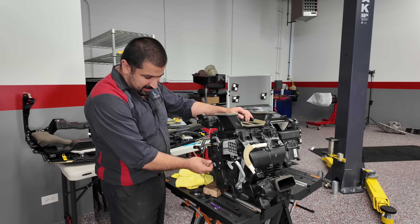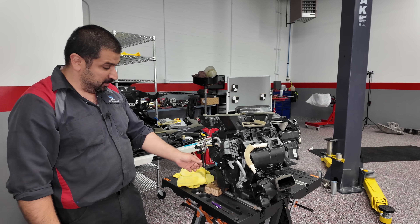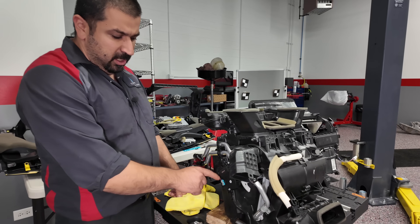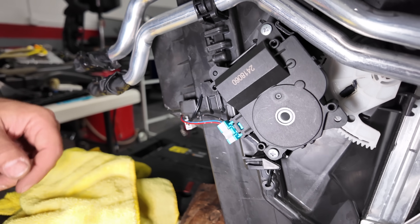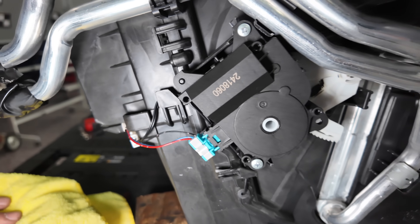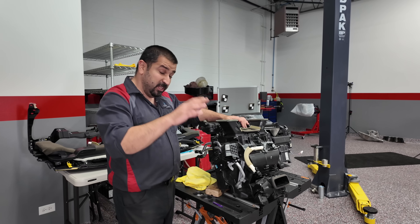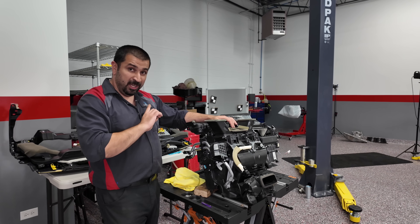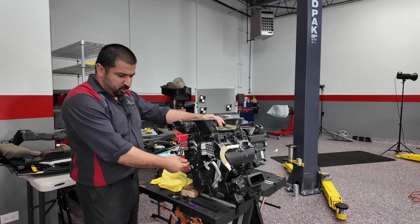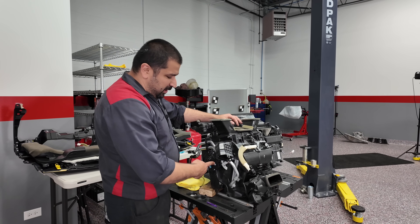This is not a two-wire servo — it's a three-wire servo, and this is very important. With only two wires, the computer will spin it one way and then flip the polarity and spin it the other way. But the third wire is the position feedback, so the computer knows the position of this motor. In Toyota and Lexus cars, every time you start the car it runs a servo check — it actually moves the servo a little bit back and forth just to establish the position.